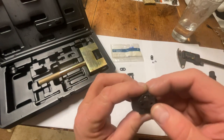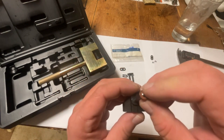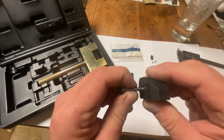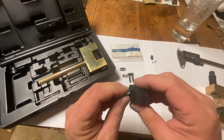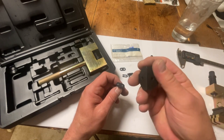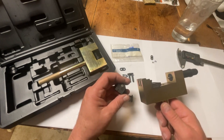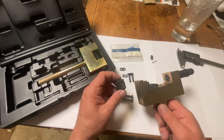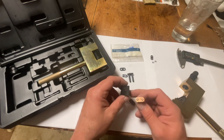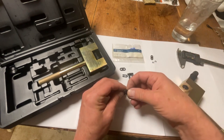When I insert the actual link cover, you can see that it no longer fits exactly in here, and we can kind of slide this forwards and backwards on the magnet part. But we probably can use it. I was completely unable to find the dies for this kind of tool in standard size. You can get them in metric, and you can get them in the numbers to use on motorcycle chains, but you cannot find a die for a three-eighths by seven-thirty-second chain — because that's basically what that is. And that has three parts to it; the middle part is a tad bit thicker than the outer parts.